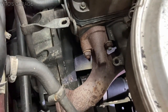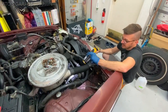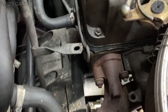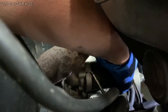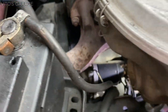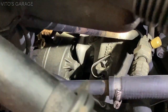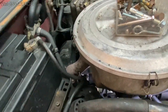It's pretty insane. Sean bought this car a few months ago and it was starting and driving. But it's bizarre — I see some metal shavings right there on the block. If I wiggle this starter, look — it is literally loose in there. It's not attached. Two bolts on the starter are literally missing. The only thing holding the starter from popping out is a bracket on the back of the starter motor, and it's not even attached properly. Just those wires that are attached to the starter are holding it.